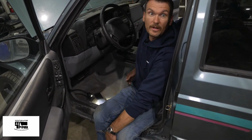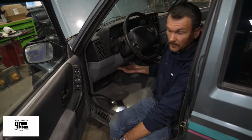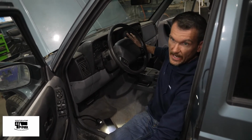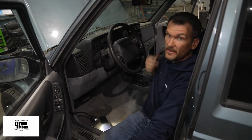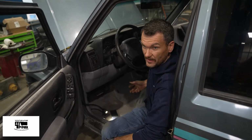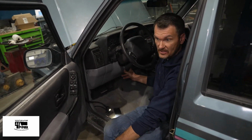Now that the seat's removed and the battery is disconnected, we're going to remove 3 dash panels: the kicker panel underneath the steering wheel, the cowling around the radio, and finally the main dash panel surrounding the instrument cluster. There's a 4th hidden panel that's not really a dash panel behind the kicker panel. It's metal, and we'll remove that too.